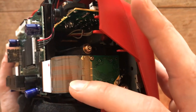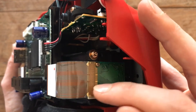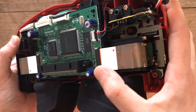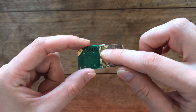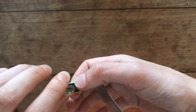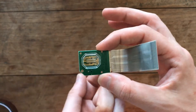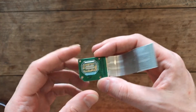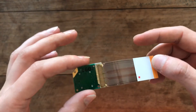What I'm going to do is take these out, cover this in some Kapton tape, and then have it resoldered for a secure connection from the board to the cable — that's all there is to it. I've got one out now. I'll cover this with some heat-resistant Kapton tape. What you want to be careful of is the bottom side — this is the laser sensor unit — and when soldering on this end of the board, whatever flux you use, you don't want it to get underneath this because it'll mess it up.